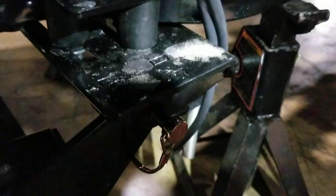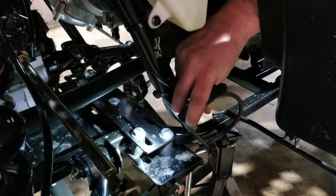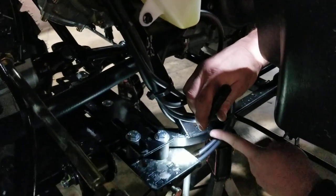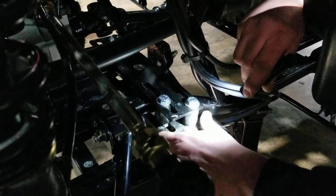You're pretty much sandwiching the frame there, right? Exactly — you're going to sandwich the frame with those plates that are included. Then you just want to take your bolts and have them right up against the front face of the frame rail where it comes out. As the frame bows outwards, this is where your bolts are going to attach, so the plow does not get pushed back.